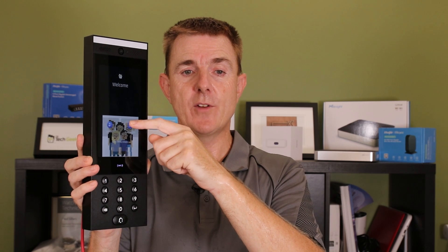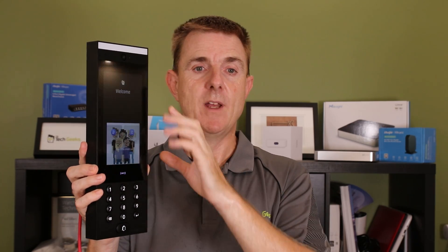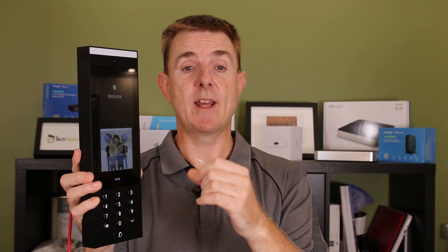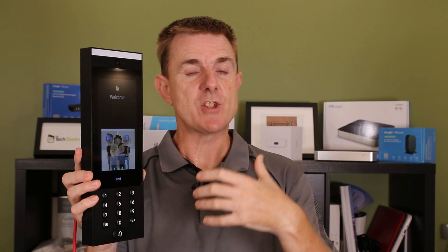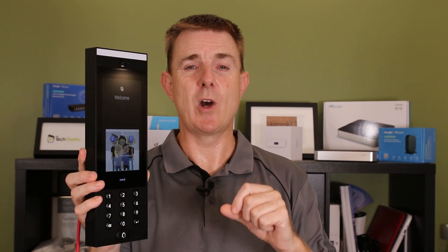We've got other options in here for QR code — you bring your mobile up to this with a QR code that you maybe send to friends, family, or a business colleague to get access. You've got your NFC down here where, if you're using the UniFi ID app on your phone, you can bring that up and if you've got access, tap it over. You can then define the number of actions — from unlocking the door to having a two-way conversation. If I push this button and it calls me, it appears on my mobile and I can have a conversation and choose to unlock the door. We should have the UniFi Access Viewer to look at hopefully next week — each tenant could have one of those viewers and it's also going to work with the G4 doorbell soon, which will be a really significant thing.